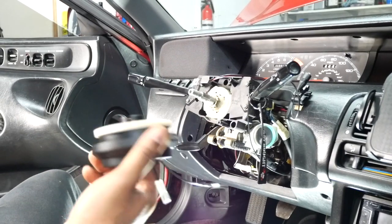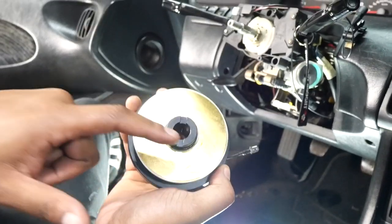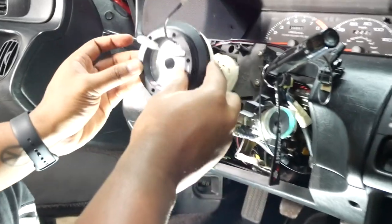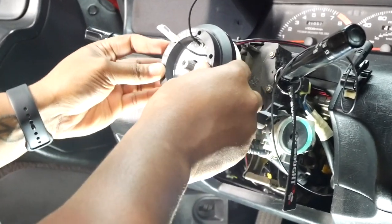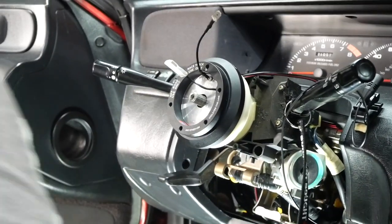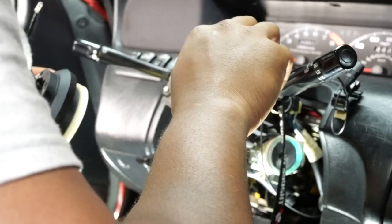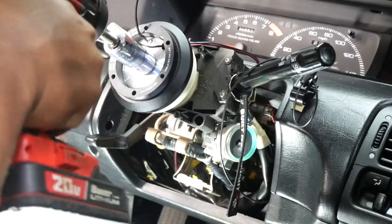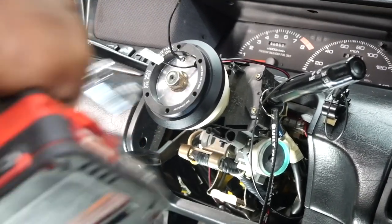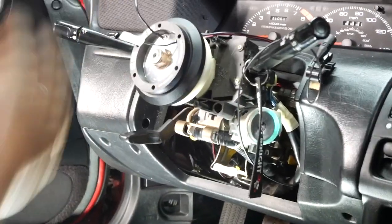With this car — I don't know if this is vehicle specific — but there are two indents right here. You have to line up the hub into those two indents and it should go right on, just like that, perfect. Then you want to take the bolt, put a little bit of Loctite on it. You're supposed to use Loctite blue but all I got is Loctite red, so I'm going to use just a tiny bit because Loctite red goes too crazy. That bad boy is on there — I can steer the car with this.